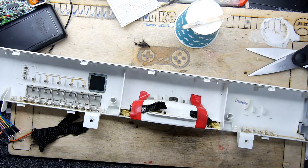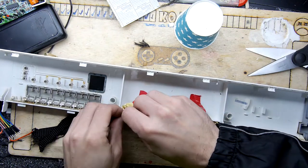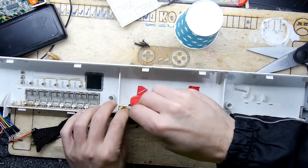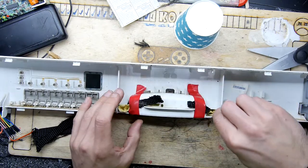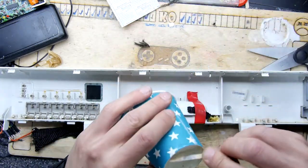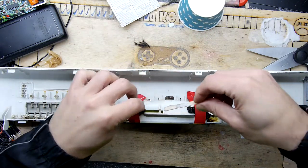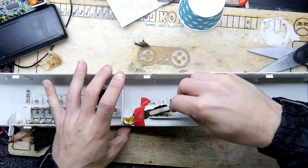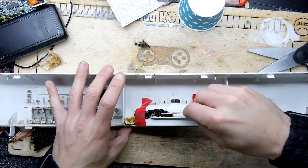And look at this paper I'm shoving in here, for example. As long as these cavities don't need to be clear, you can leave the paper in, or why not just put more resin all over the top of the paper, and then that'll become a big solid old block of stuff. Now, the resin in the tubes that I'm using is only like a pound for the whole two syringes, the way it comes. So yeah, you can afford to do this. Just do it. Why sacrifice the strength of this whole thing for the sake of 10p's worth of resin? So just go nuts with it. Go nuts, absolutely. Go nuts with your donuts.